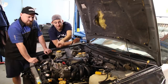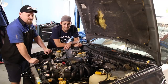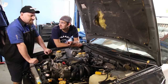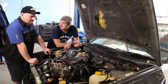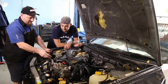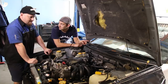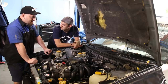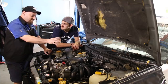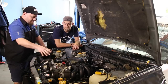So that's the hot side coming out of the turbo, cool through the intercooler, and on the cold side it'll be a traditional 180 sort of thing down to the pipe - avoid everything in the way. Once that's in, fuel lines are probably the next thing. We're going to have a custom fuel setup because this is actually a returnless fuel system, and we're going to leave it that way. In the past I've made them into a return system, but it clutters things up with fuel hoses. This model car is set up to have a return, but because this engine is newer, most stuff is returnless these days. We'll have a regulator and a fuel rail with fittings - it'll return back to the reg and feed the two fuel rails on the engine. We're going to have a fuel pressure sensor on there as well.